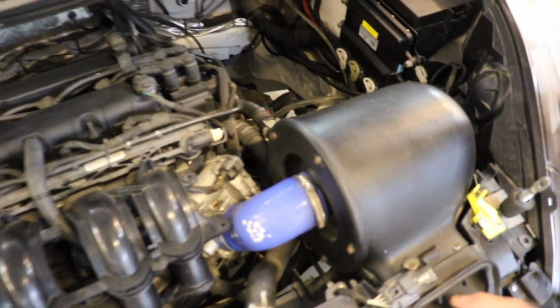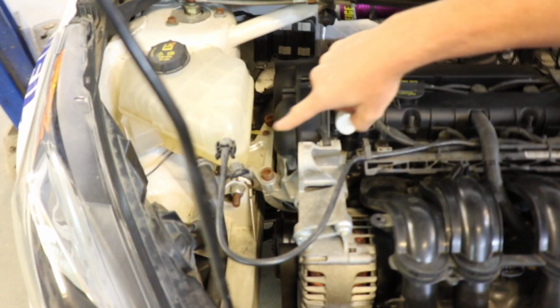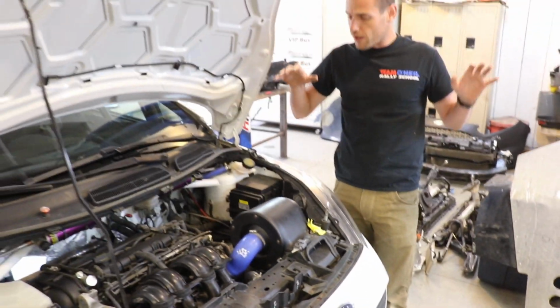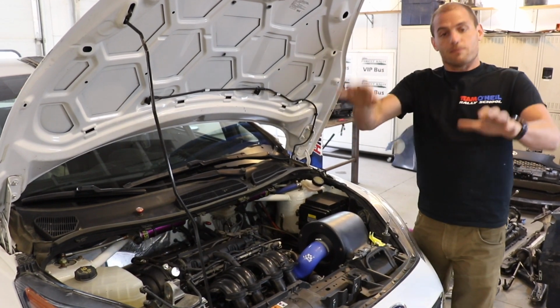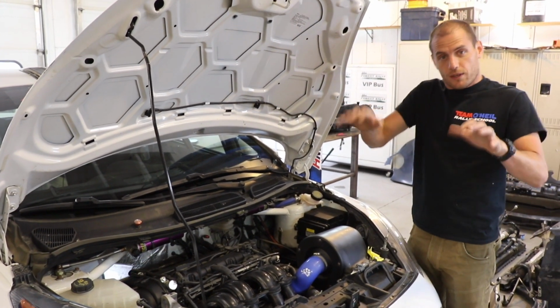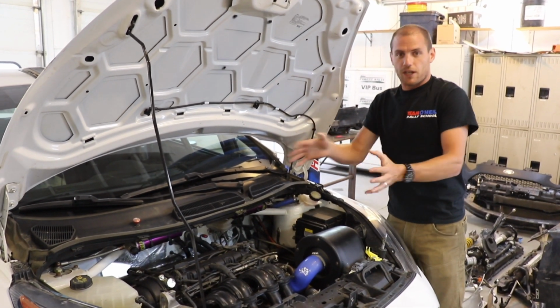Big beefy motor mounts are crucially important. Something like this is going to be much more heavy duty than what you would find, because as you're driving on a rough road, especially accelerating, especially over washboard bumps, or we call them turtle bumps sometimes, but you've seen them on dirt roads where the car's hopping, this engine's moving around.